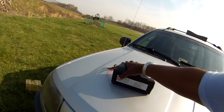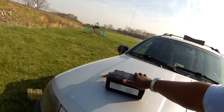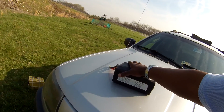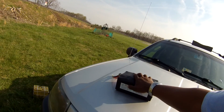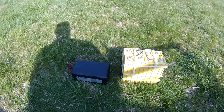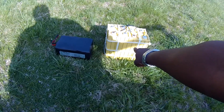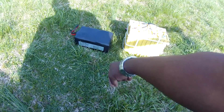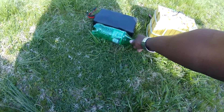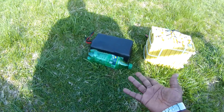These are high-power cells, so they have more energy condensed in a smaller area. This actually consists of two 20 amp hour batteries. Each battery is wired with four cells in series. Put both of the batteries together, run them parallel to get double the capacity to get me up to 40 amp hours. To put things in perspective for size, here's my old lithium-ion battery — 20 pounds — and here's my new battery, which weighs 9 pounds. And that's a 20-ounce soda bottle. So it's very small.